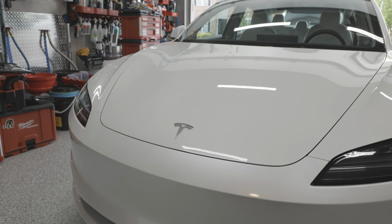So let's talk about aftercare with Inspiration Stout. So what happens, when can I wash it, etc. So the vehicle can leave your shop, your garage, wherever, within about an hour minimum. You should not wash it for 48 hours with chemicals, but after that, you're okay. If you can let it sit in your shop longer than an hour, that's great. It just allows additional curing before being exposed to any natural elements. You can also top it with Inspiration Defender from P&S, which is an SiO2 spray.